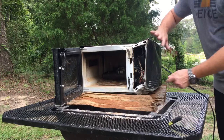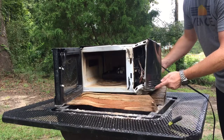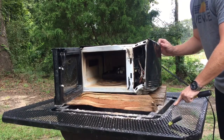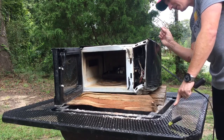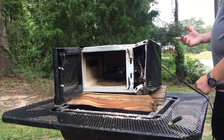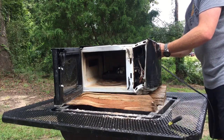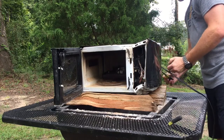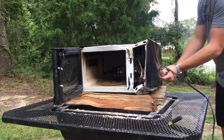What you have is screws around the backside, and the whole top cabinet kind of clamshells on. It's held down by screws on the side, and you have security bit screws in the back — you use a star bit, I think it's a T15, and it has to be the one with the hole in it. You can get a set of those security bits at Sears, True Value, Lowe's, Home Depot, or any hardware store.